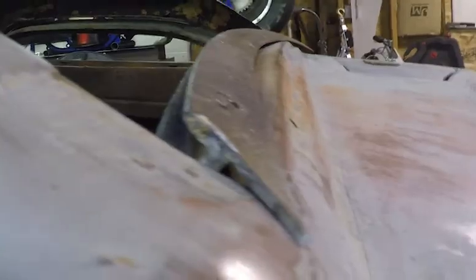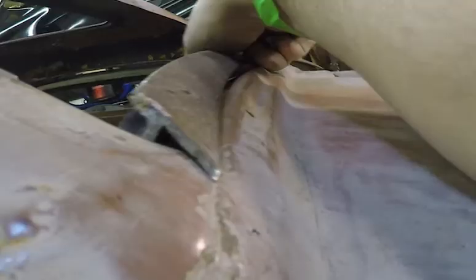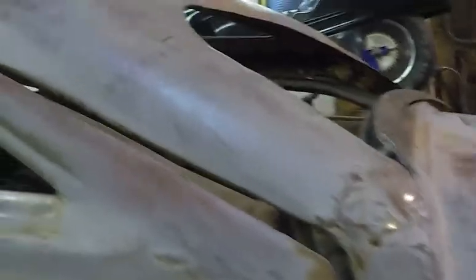So as you look at the bottom of that frame, leaning back at the same angle, you see how much that comes back up on top of the cowl, which I think is just going to have to be that. If I don't do it that way and put it out here on the front, I'm not going to get this to sit down from the original lip. It just ain't going to happen, because of them not relieving the cowl here and bringing everybody back on the same plane. It's going to make it tough to make this right. Most people will tell you this is not the way to chop a car, and if I was chopping a car today, I wouldn't do it this way by leaving the nubs here, obviously. But this is the way they did it in '54, and we're not changing the top because it's cool. We're just going to make this windshield frame fit this opening and have it sit up on top.